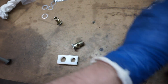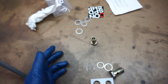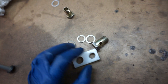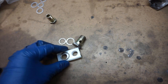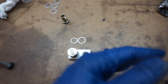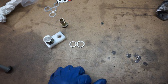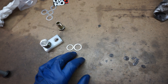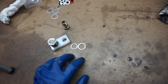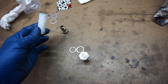Here's what I decided to do: I'll use the old washers and put this all back together loosely, put new fluid in, then run the rack back and forth. I'll pull it off, run the rack again, and hopefully it'll spit out a bunch of mixed fluid. I'll just do that over and over to get a bunch of new clean fluid in there. When I'm actually ready to put it all together properly, I'll turn the camera back on and show everybody that.